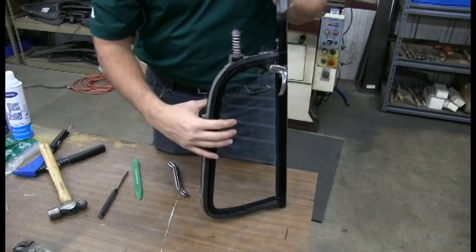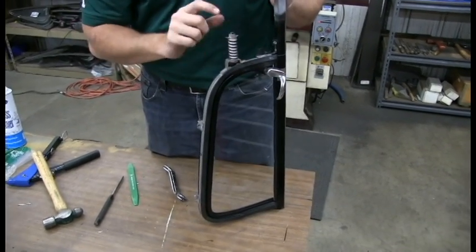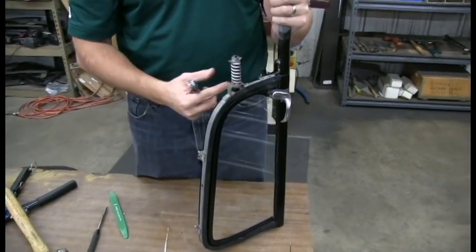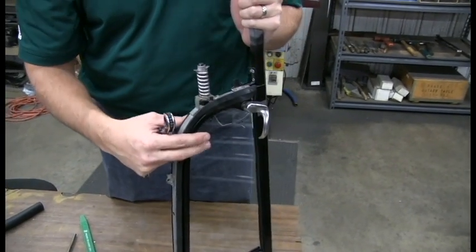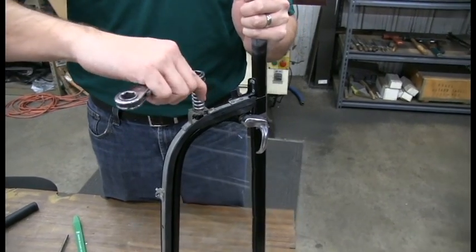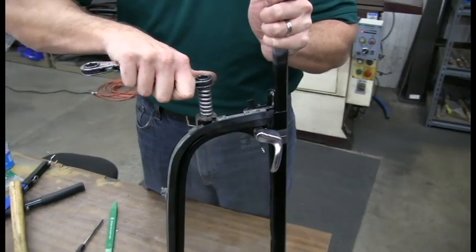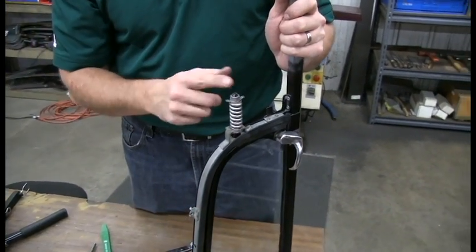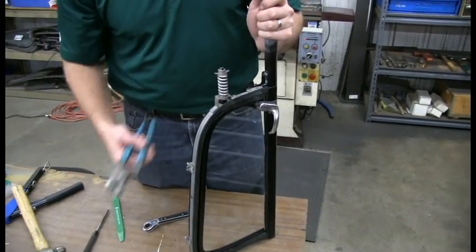All right, now we got the glass set in, handles up. You just need to get this the right tension and set that by how hard it is to close it and open the window. You want it kind of tight, but not too tight. So we did some testing. So now what you need to do is just bend these tabs back. Take the pliers.